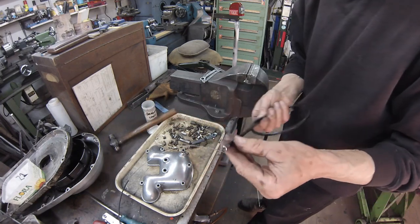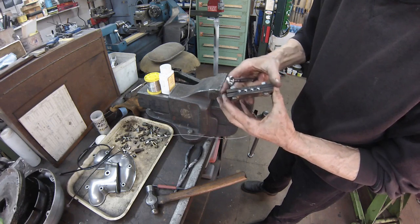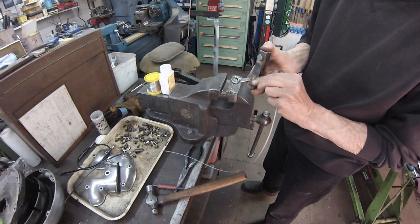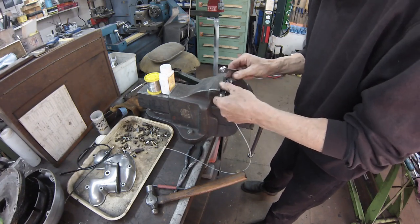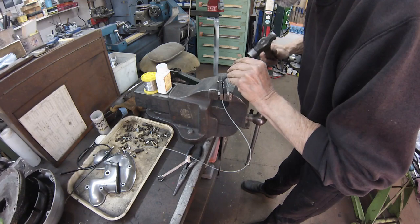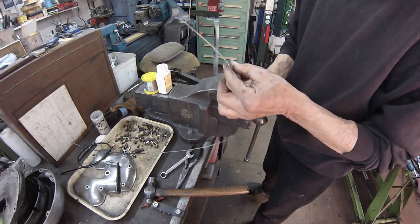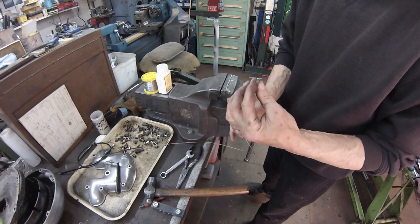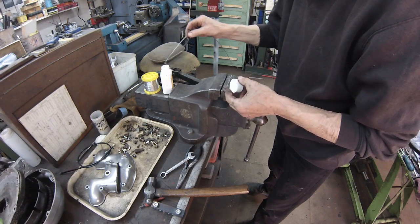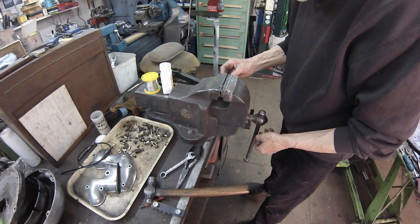Cut the outer cable to a length which will give nice easy bends from handlebars to rocker box. Create a mop top head on one end of an overlength inner using the former clamp and a hollow punch. Slip the first nipple on from the plain end, and with everything spotlessly clean, pull the formed end of wire into its recess. Dip it in baker's fluid, get it all hot with the iron, and flow in solder.